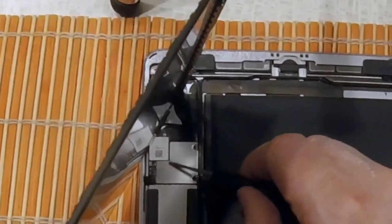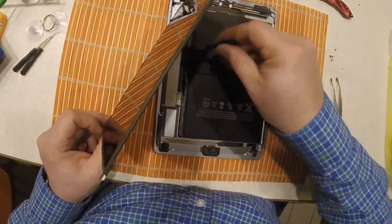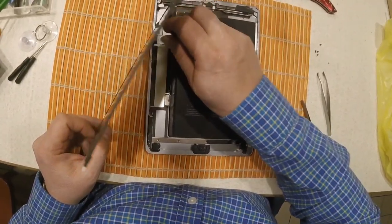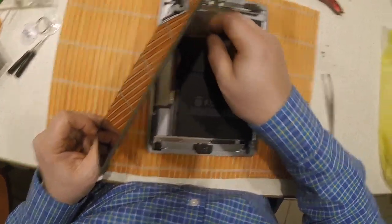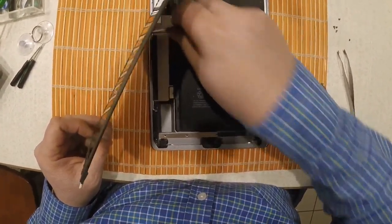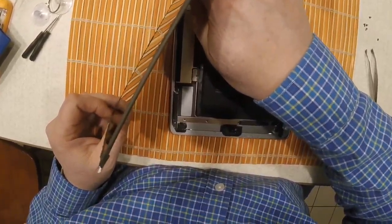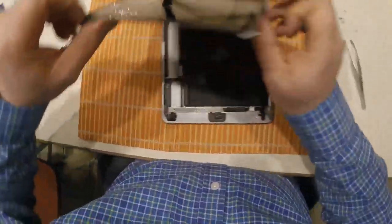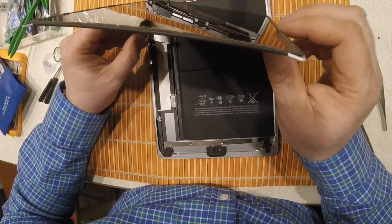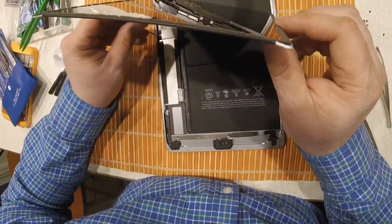When I remove the LCD here, it's attached — there are three screws holding the LCD panel with a ribbon. It's like a little metal shield, and there are three little screws there that you've got to remove. Those are really tiny screws, all the same size. The four screws that hold the LCD panel are larger; the three that hold this little shield are smaller. The LCD panel comes off — and this is what I should have done before I ripped the digitizer glass off.